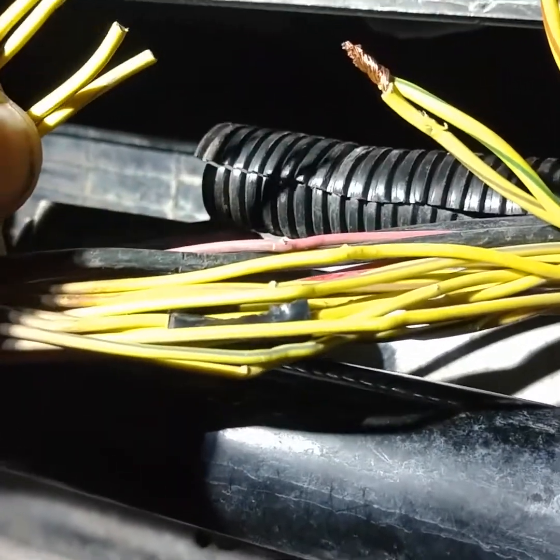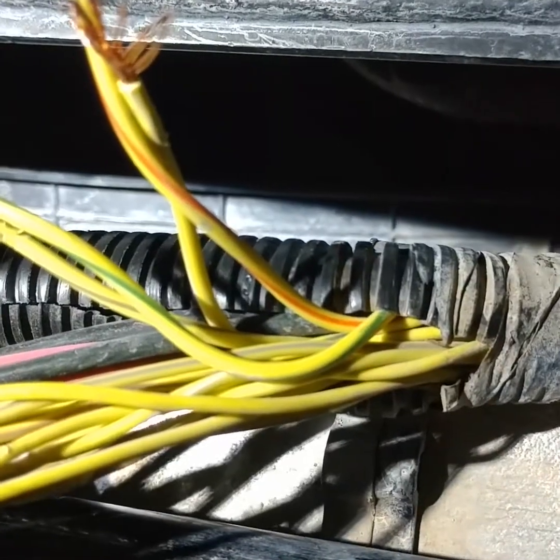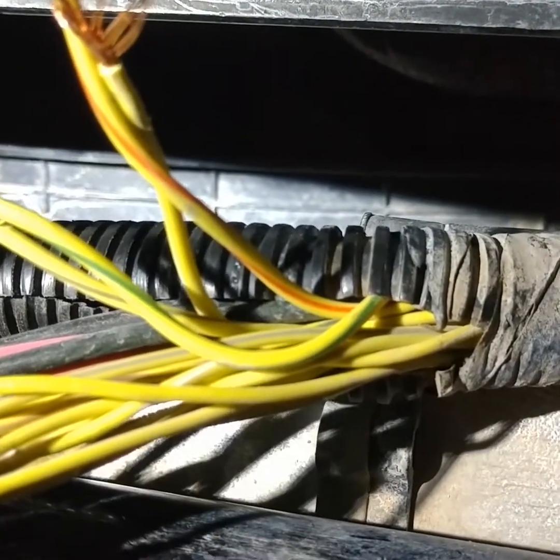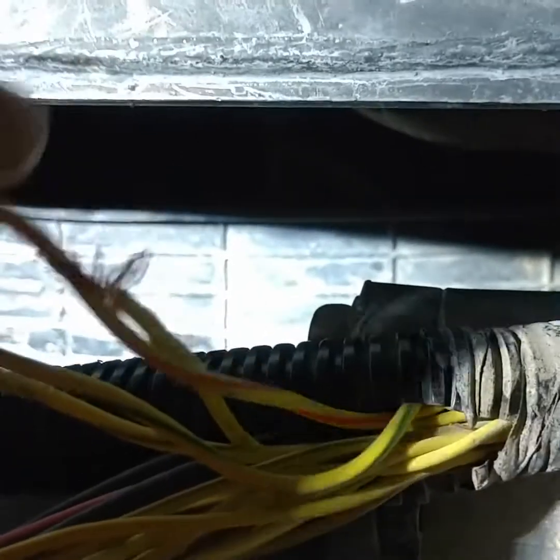On the rear locker, both yellow wires — one has a brown stripe and one has a white stripe. The brown stripe is your ground. So I put the two grounds together — the yellow-green and the yellow-brown. They only run on 10 amps, so any switch will run them; you don't even have to monkey around with relays.